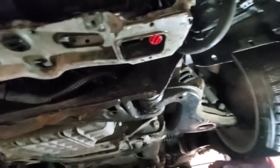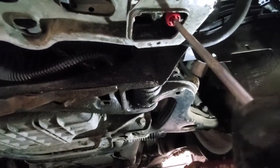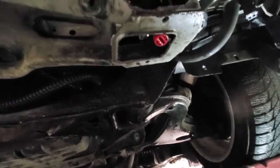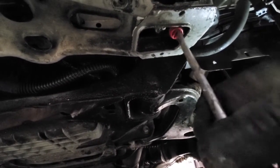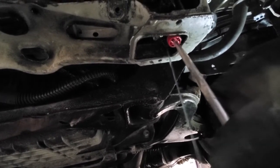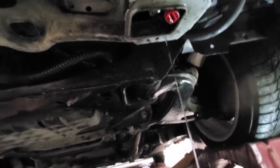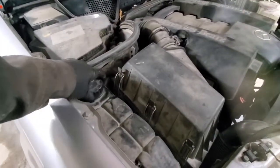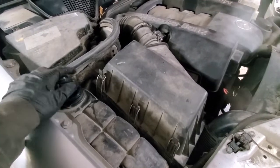But first of all, as I said, we need to drain the coolant, and you should just get this plug loosened and it should start draining. If you can attach a hose, it will be much cleaner job, but in case you cannot, we'll just capture it in an oil pan. Next, we will open the fill reservoir cap, and that should let fluid drain much better.